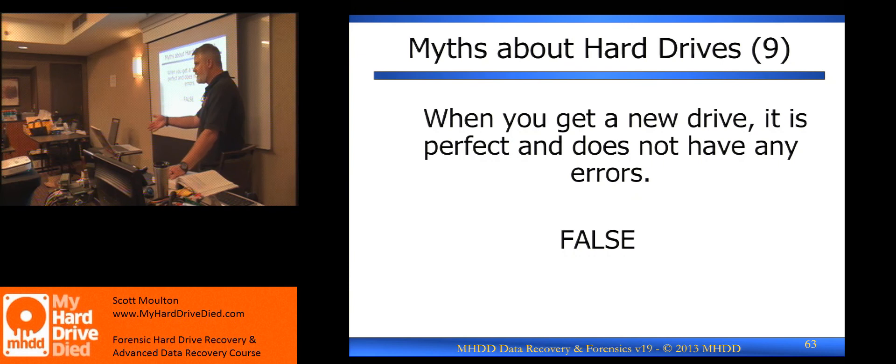When you take a drive working fine in another system but with a different sector size and plug it into a write blocker, the write blocker crashes — no prompt, just locks up. When you know something's working but the write blocker fails, you start investigating why. AS400 drives also use four hard drives in a striped configuration by default when built.